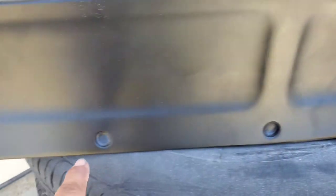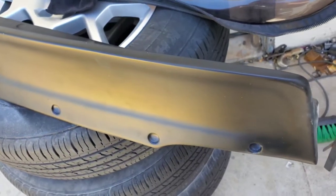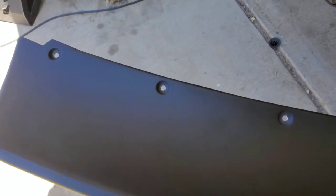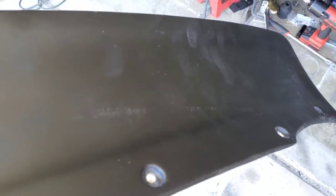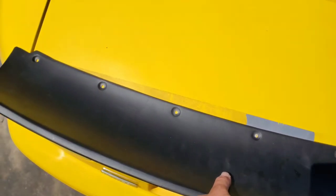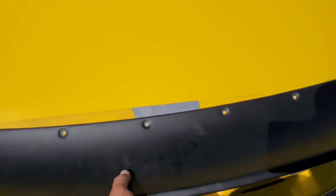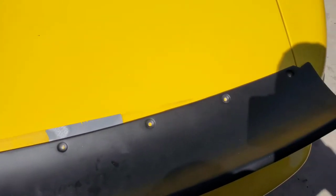Now I'm going to drill quarter inch holes, mark them on the trunk, and drill out my 5/16th holes so I can use my quarter-20 rivnuts and mount this up. I got all my holes drilled in the wing — it was super easy, front and back. Now I'm going to take some painter's tape, tape it down on the trunk just where I want it, mark my holes, and drill them quarter inch first, then step it up to the size of the rivnut. I went to the hardware store and they measured it with a micrometer — it was a Q drill bit. So for quarter-20 rivnuts you're going to need a Q drill bit.